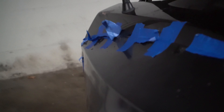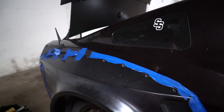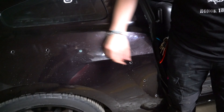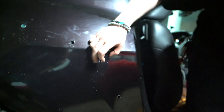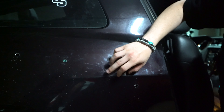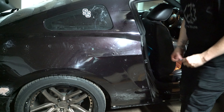We just finished up drilling the hole so I can actually fit the steel thread inserts right here. We're gonna be expanding them, but first we have to make sure it can sit properly. We need to get a deburring tool and deburr all these metal flakes. Most of the holes came out 100% — this one has a little bit of work behind it but I can push it and insert it. After this we're gonna mount this up, test fit the kit onto the car, insert these, then do the other side — same thing, rinse and repeat.